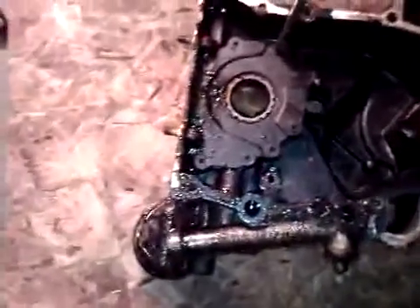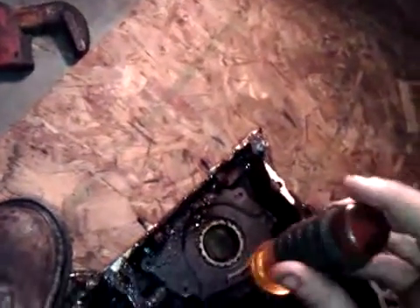What I'm going to do is take the backing plate off these pump gears and see if maybe the gears busted on it. I believe the oil pump had something to do with the bearings spinning on me. So we're going to take this pump cover — or the backing plate, I should say — off and see what the gears look like in here.